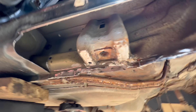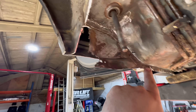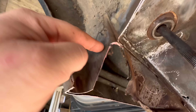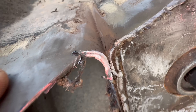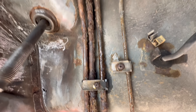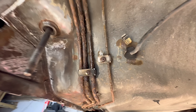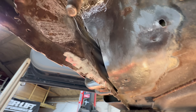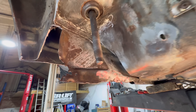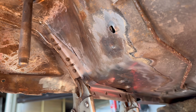Stop buying these rusty cars. We're trimmed back - luckily the jacking point is all good, just de-skinned it up to here. I think we're going to have to repair this bottom section from here up to the end, and then I can make this panel which goes around and just buttons up there. As you can see, this panel here folds onto it so it will spot down there. But as I was blowing it with the airline, I blew a hole in the fuel lines, so I should probably take them off before I continue cutting and welding - which is really annoying because there'll be open fuel everywhere, but I have no choice. Little section cut out there so we can do that edge just one little piece at a time. This is going to be quite time consuming, and this is the easy side.